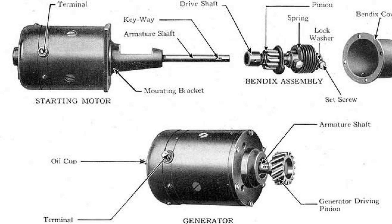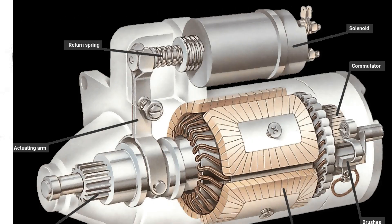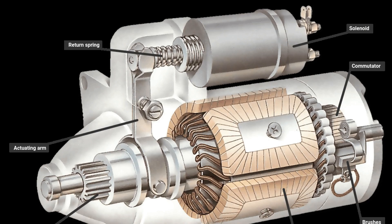From the above it should be clear what the bendix is and what it's for. Its main components are: driven cage with pinion, drive cage, rollers, springs for rollers, casing, a round ring together with the casing preventing the rollers from falling out of the grooves of the drive cage, and a shaped ring whose protrusions the fork rests against when moving the assembly.